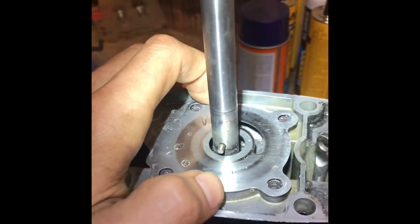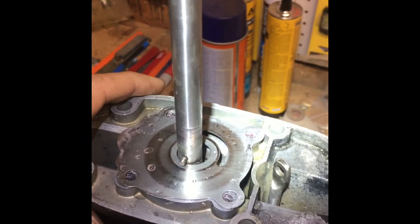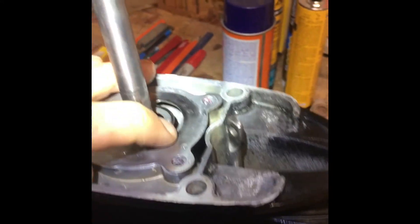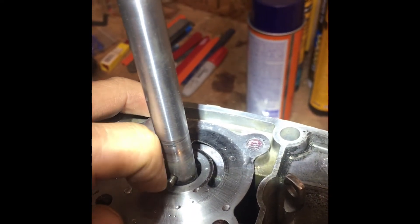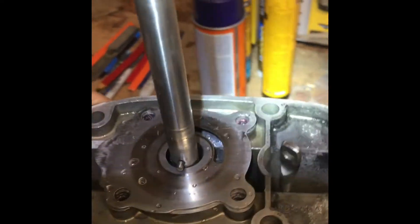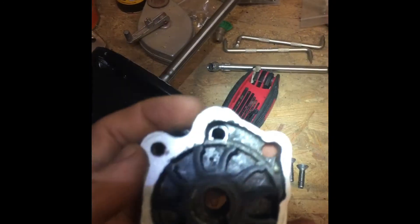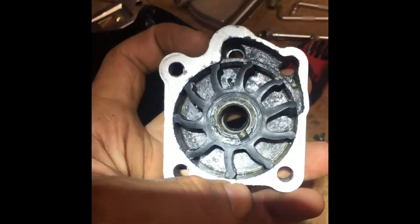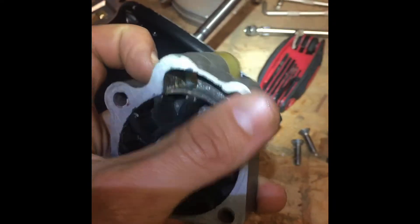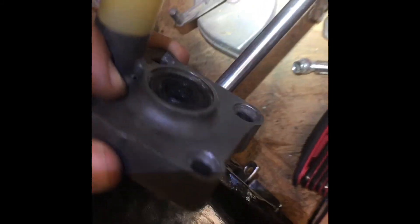From my personal opinion, adding sealant is completely useless and you just have to clean it off if you ever have to fix it. If water seeps between the plate and this housing down here, it really doesn't matter — it's just sucking water in through that little hole. Your impeller should be sitting flat on here preventing water from coming between the shaft and the housing. I honed this before and it still didn't fix my problem. If you have big notches it might help, but water being flat on the plate means it's not going to leak much there.